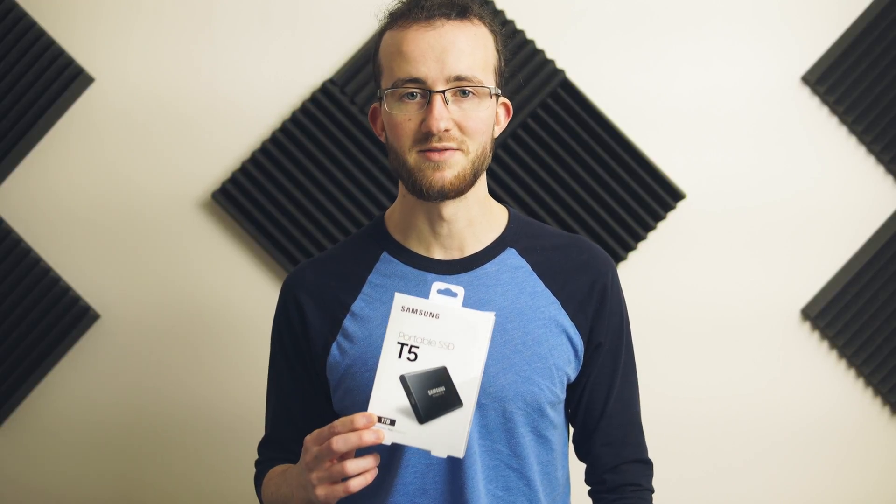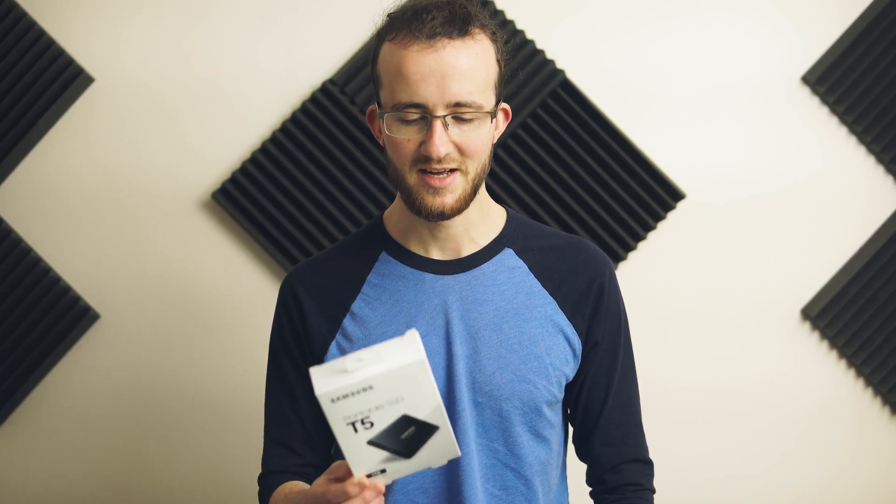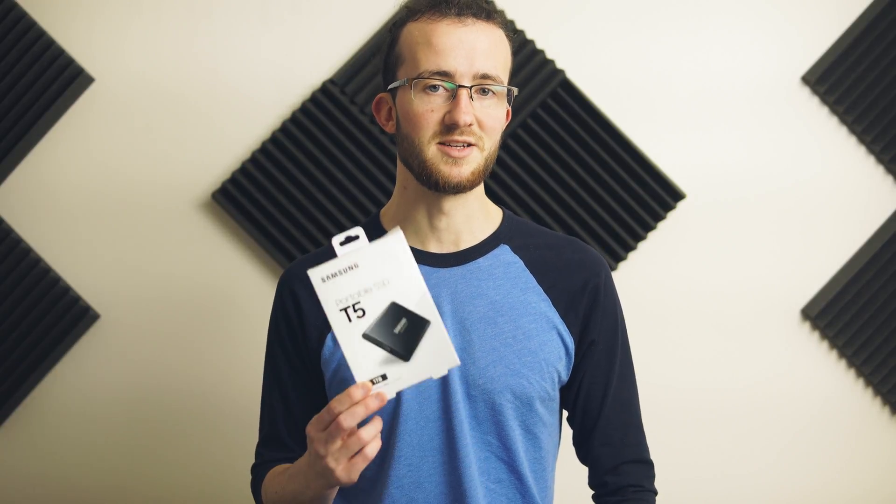Fast forward — the weekend is over. The gig went beautifully. We shot a couple hundred gigabytes for the Canadian Forces, transferred it over to the Retina MacBook Pro, and then continued the transfer to the Samsung T5 SSD. In application I really realized how big the time difference is — just a few minutes going to the MacBook Pro versus 12 or 13 minutes waiting for the same transfer to go to the T5. Transferring 200 gigabytes in 13 minutes is really fast compared to five years ago, but 3.8 gigabits per second maximum write speed really isn't utilizing the full 10 gigabits per second theoretical speed of USB 3.1 Gen 2.